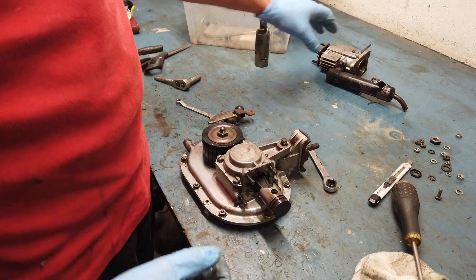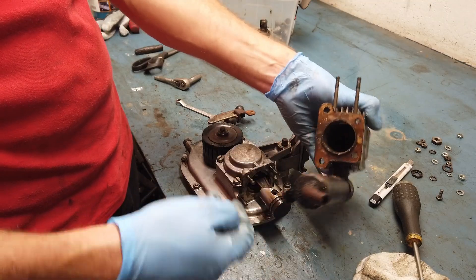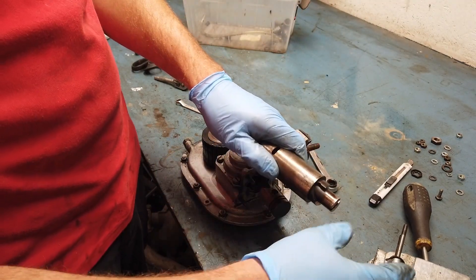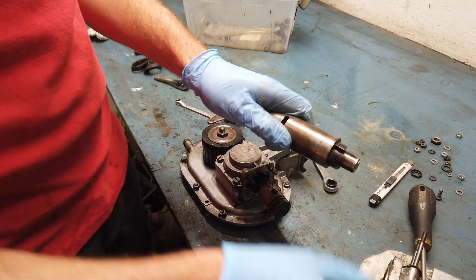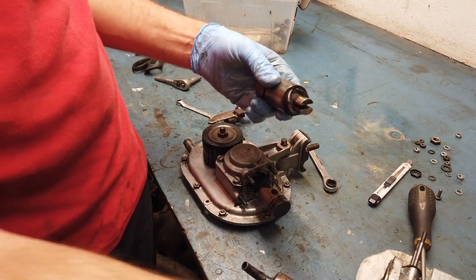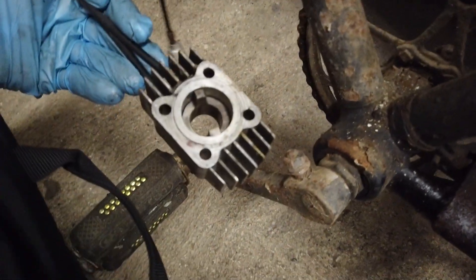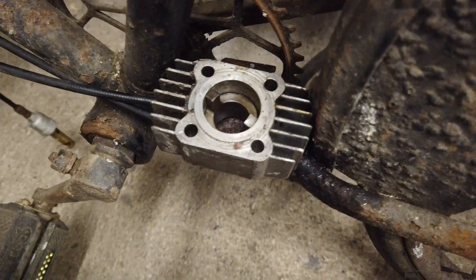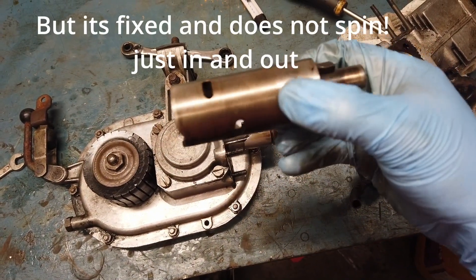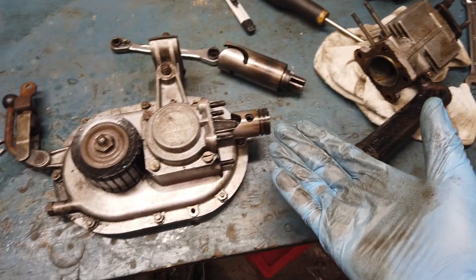On top of this goes what looks like a normal cylinder. But actually, the piston is not making compression in this bore because, as you can see, it's a lot bigger than the actual piston. This one goes onto the piston and then into that cylinder. This one has the intake ports and the exhaust ports, and at the top end it has these grooves that fit together with the cylinder head. You can see two notches and two cables going to the handlebar. If I turn the handlebar on the left side, they turn, and when they turn, they will force this inwards and outwards, which will lower or raise the compression. So this is a variable compression engine, which is amazing.